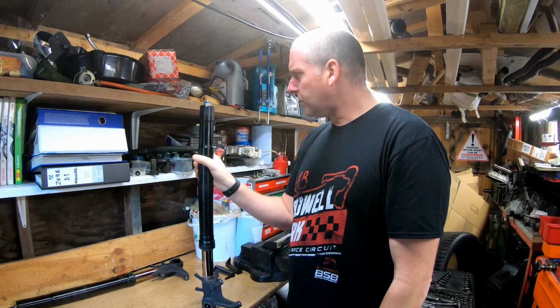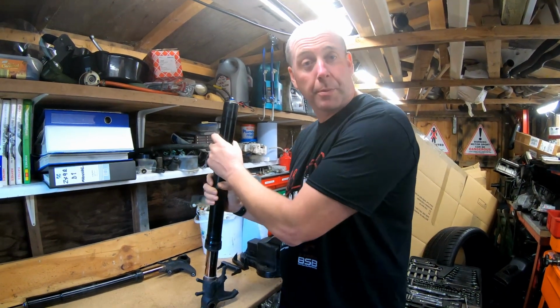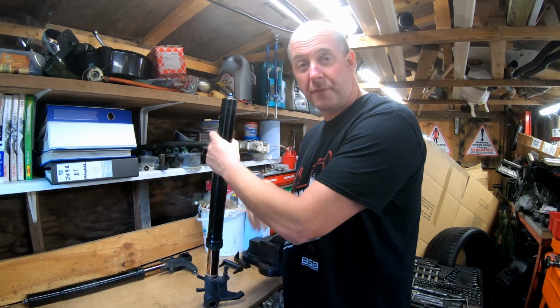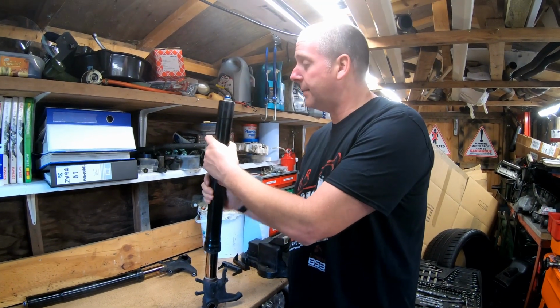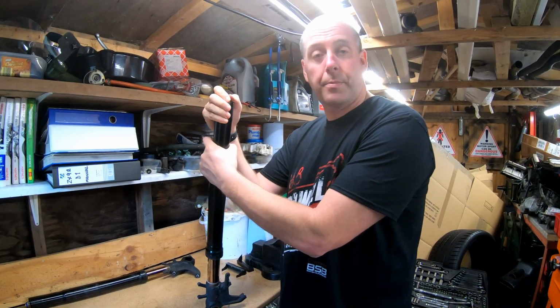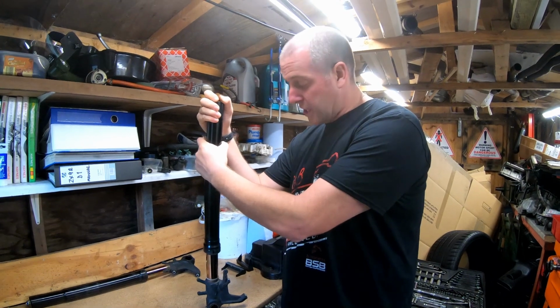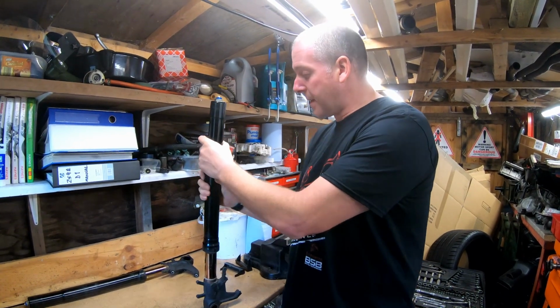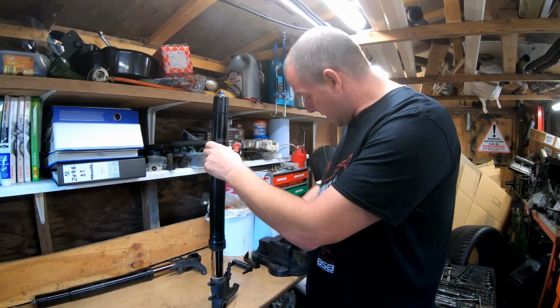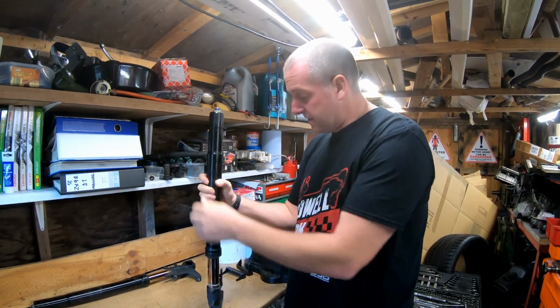One thing to note is I told him to drop the forks out, drop them over to me, and I would do all the stuff and film a little video for it. One thing I did forget to tell him to do is crack off the top nut whilst it was in the yokes. So that's going to be a little bit of a challenge. Hopefully I'll be able to get a good purchase on them in the vise. I've got my rubber clamps. Hopefully we'll be able to get it undone without too many problems.